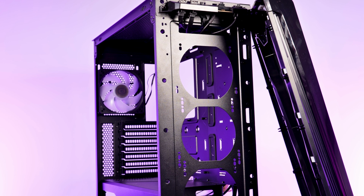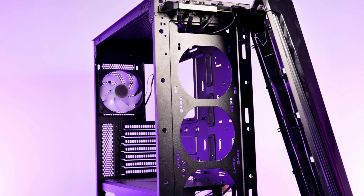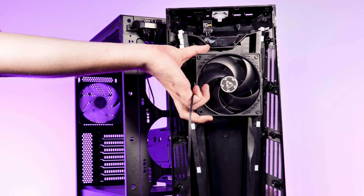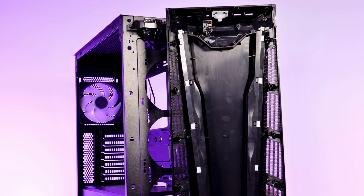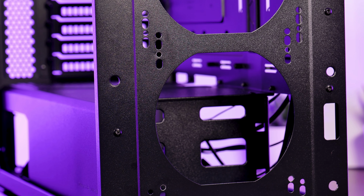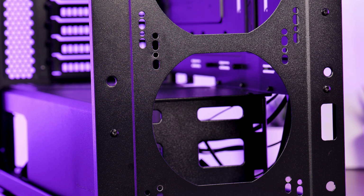Now on the airflow. Really bad job, Cooler Master. The fans which are supposed to draw air into the case are almost completely glued to the front panel, which is sealed by all of that plastic. Sure, there's a tiny air pocket in front of the fan and air gaps on the sides, but the upper 2 fans are physically unable to reach the air vents. So what good are they for? The lower fan is the only one which may be able to somehow reach the air vents, but it is also the fan with the least amount of effectiveness, as it is just blowing air straight into the backside of the drive cage.